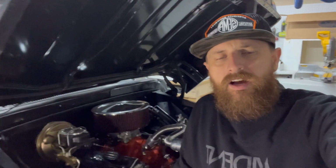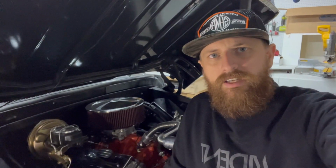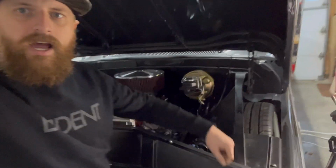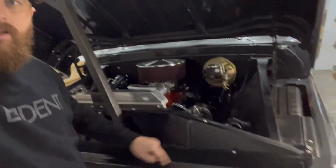So yeah, what I want to focus on now is just installing the 4-gauge wire from the alternator all the way to the battery. So what I'm going to do first is just uninstall all the wiring currently going to the battery and then run the new wire all the way to the alternator. Now I do plan on moving the horn and the fan relay and all that kind of stuff actually to behind this panel right here.